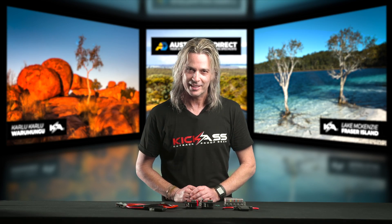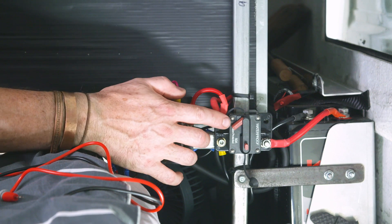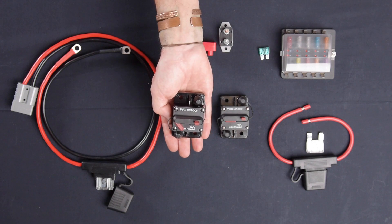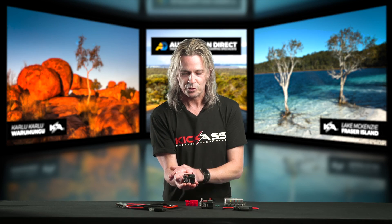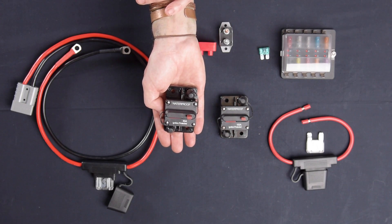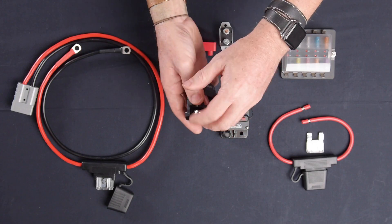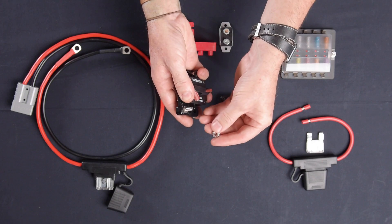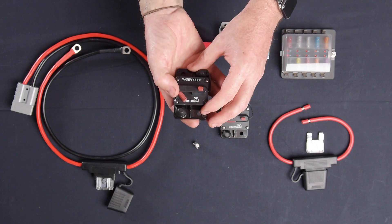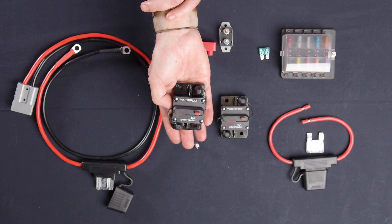Next up are our 50 and 100 amp resettable circuit breakers. Look how good they look — they're great for any custom wiring application, practical, and you can use a whole heap in a system. Unlike normal fuses that you have to replace when they blow, when this trips the little arm comes out indicating there's been an issue. Nothing can be used again until you manually click it back on. Find and rectify the problem, then reset it. You can also unclick it to disengage the circuit for long-term storage to prevent battery drain. Heavy-duty stainless steel ring terminal posts with locking nuts and protective rubber boots keep live wires safe.